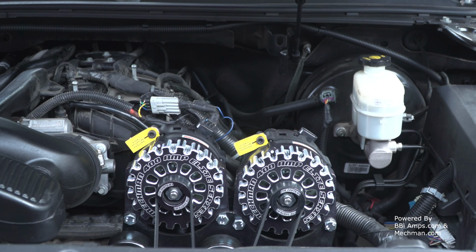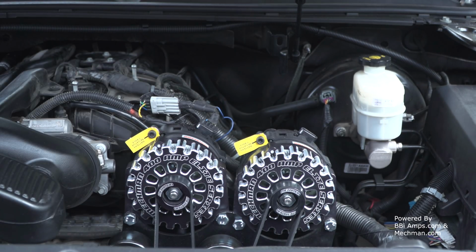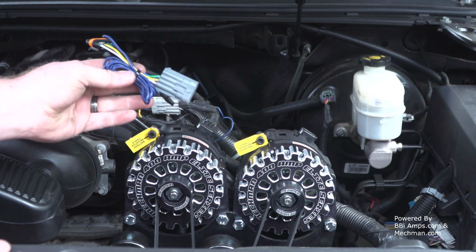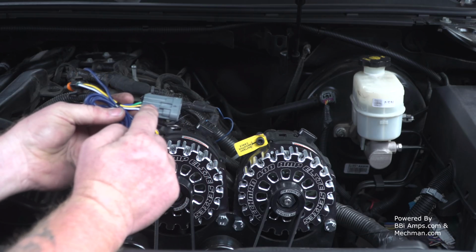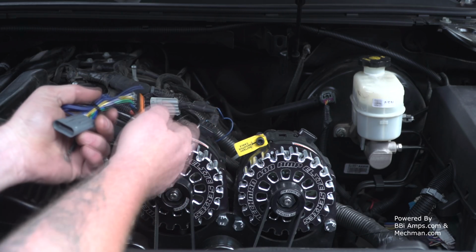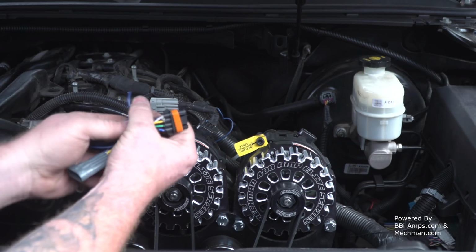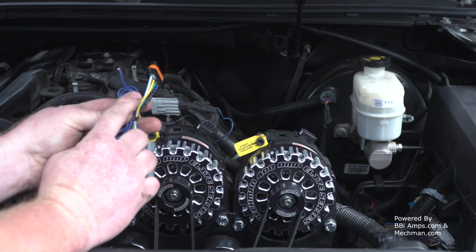Okay, a couple little last tips and then we're going to wrap this up. The system works great. I built a new bar to go from here to here and then take off to my 500 MCM wire that I'm going to install. I wanted to talk about the harness, this thing. You'll notice that there is this 4-port plug and then its married partner. The plug plugs directly in here to the top, but this blue wire attaches to a switched 12-volt source.